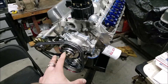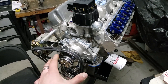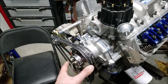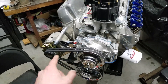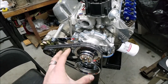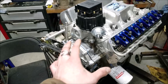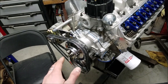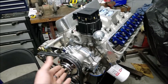The point of this video is to look at this front timing cover and water pump assembly and its parts and pieces. It seems like it should be a pretty easy task to find things that all line up nicely without any fooling around, but it ended up being very difficult to some degree. I'll leave all the part links below so you can source this if it's something you want to do. The 80s blocks have reverse flow water pumps and a lot of different stuff that doesn't really work with our old-school 60s cars.